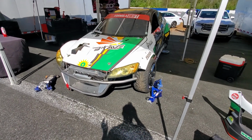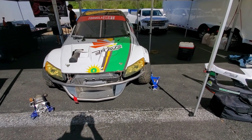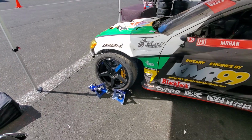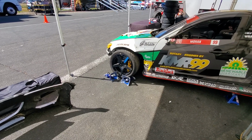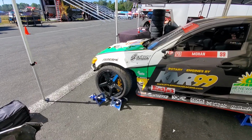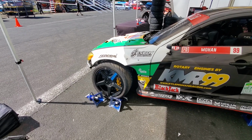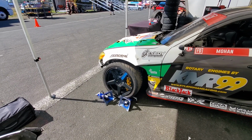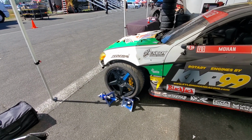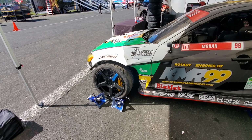And then as far as the camber settings go, I like to run a decent amount of front camber, and I think this really depends on the geometry of the car. On RX8s, we're setting it anywhere from about 3.8 to 4 degrees, upwards of 6 to 8 degrees, depending on the track. We don't have a lot of front stagger in our suspension geometry or alignment settings, so the front end stays pretty basic most of the time. Slight toe out, decent amount of camber, make sure you're running a decent amount of contact patch while in drift.